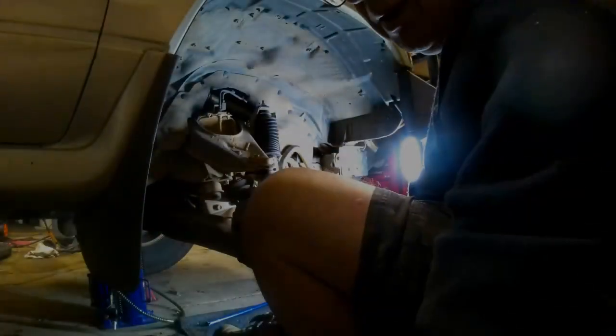In the video here, you just saw me tighten up the nut on top of the shocker as tight as I could. That's not correct, and I just want to correct that here. What you need to do is tighten down those nuts until you see the bushes tightening up and squishing out. As soon as that happens, you need to back off the nut about half to one turn, otherwise you'll damage your rubbers. So I reckon that's done, so it's wheel back on again.